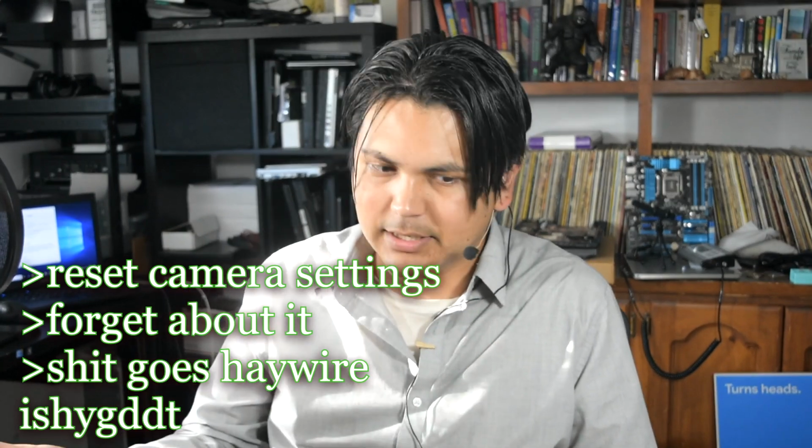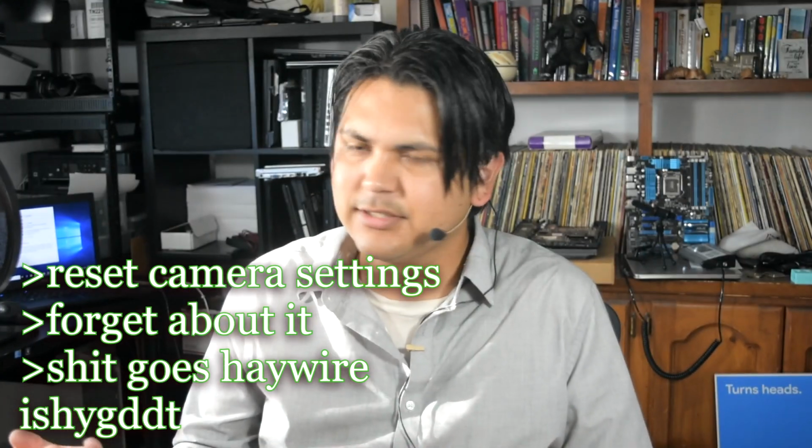Okay, so it should be obvious that I cannot do anything with this laptop now. I'm not going to feel confident in dremeling the sides for the USBs to fit and all the I/O. The main part is that I'm not sure how well the DC jack will connect if I bought one for the G6 or the G7 model and tried to put it in the G62, whatever the hell it's called. So it would be too much time investment to see if it works. And additionally, I'm not too sure if this actually does work.